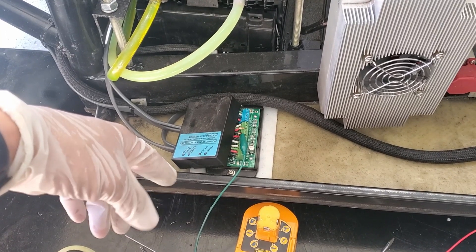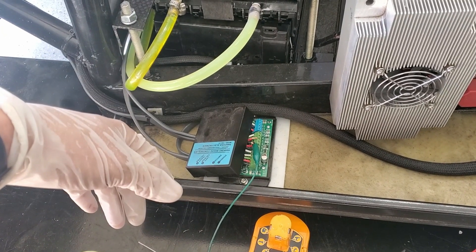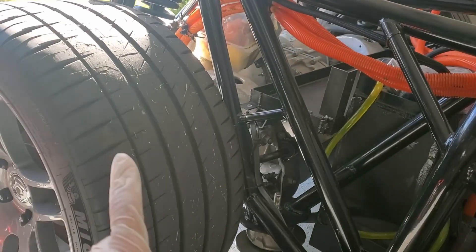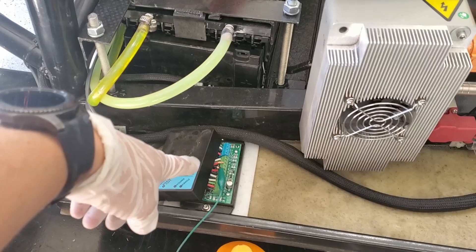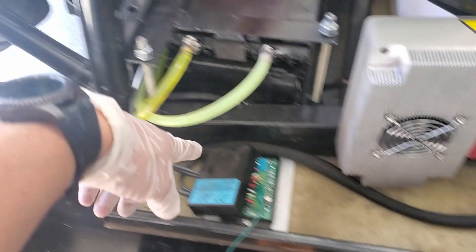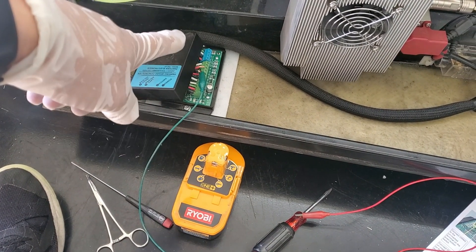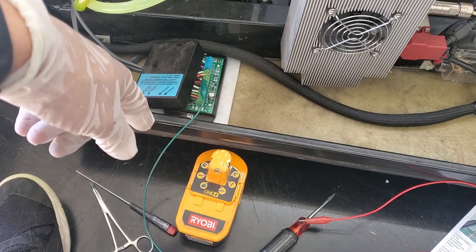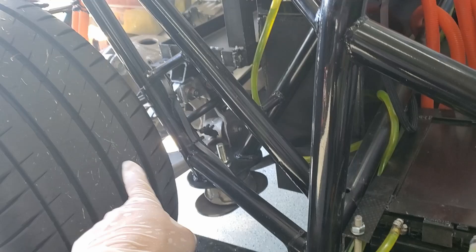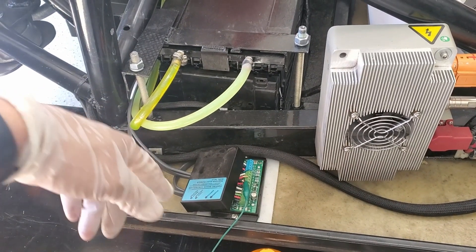The theory was that the motor for the parking brake was jammed or stuck open. The left — driver's side — was working, but the right side was stuck open. The manual workaround is to use a 12-volt battery from a tool and connect it to the positive and negative wires going to the motor, just to open or close it in a pinch. I tested it — the motor works, it's not jammed. So we'll hook everything back up and see if the issue is corrected.